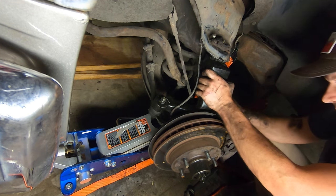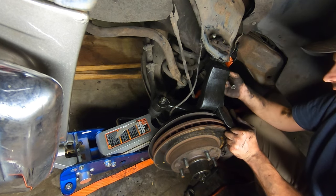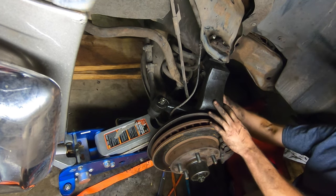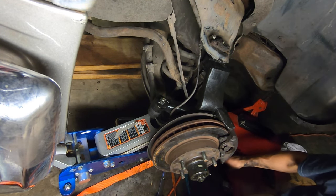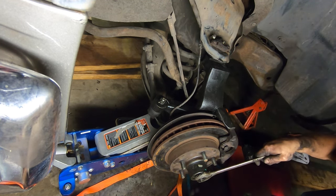Once you get down here, you kind of gotta take these pins out and look down in there with a flashlight to line it up — that just took me entirely too long to line those bolts up. Tighten this up. Also almost forgot to show you installing the front shocks — all you do is two bolts on the bottom, one bolt up top. The whole thing can slide down through the bottom, pop the new one in, tighten the bolts back down, and you're good to go.